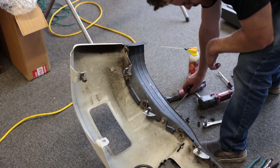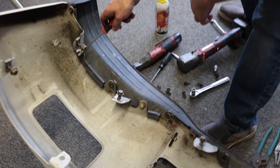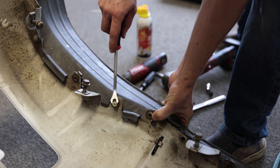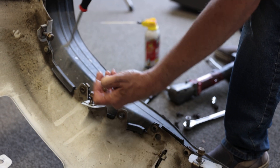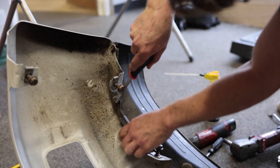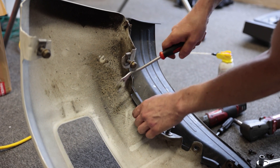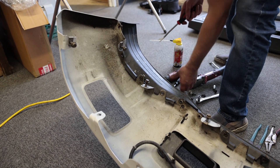There are still plastic clips holding this into the bumper — two right here and two on the other side. We're going to take our clip removal tool and pop those out just like that. It's a two-part clip. Honestly, sometimes metal is nice but with something like this I prefer plastic holding it in because that doesn't rust.